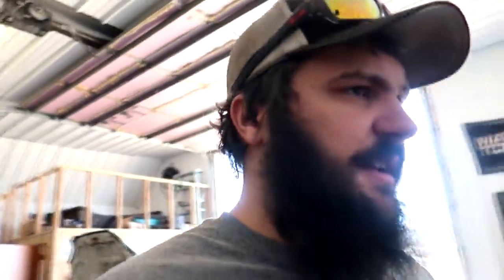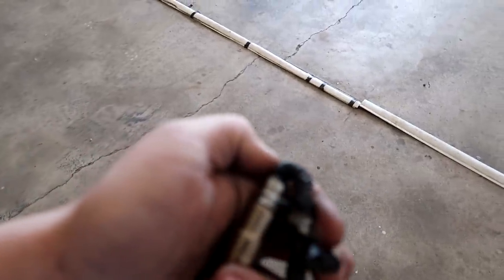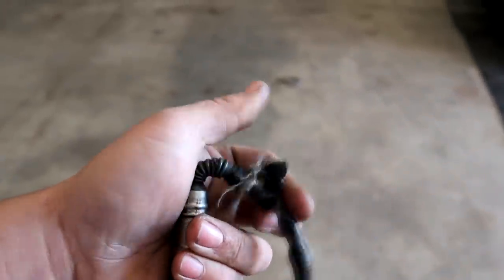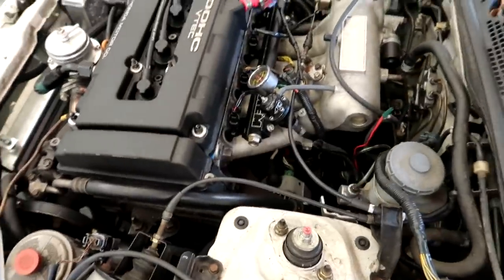I went under the car and replaced the sensor. The old sensor that was in the car is right here — I already tore it out. This bend was pretty much hitting the shift linkage, and you can see it's all torn up where the shift linkage was rubbing on it. I ended up changing the O2 position to the one under the intake manifold down there and put a new sensor in so it comes straight up and down and nothing can interfere with it.